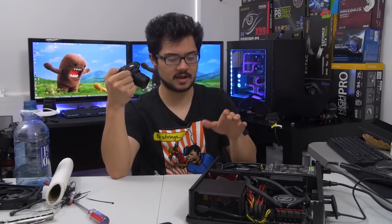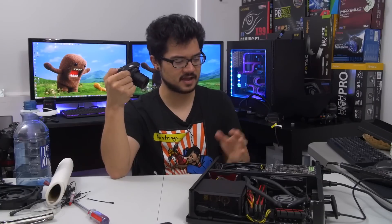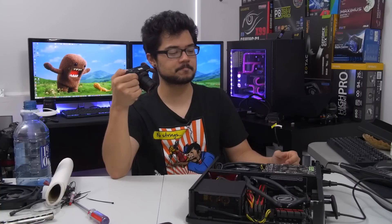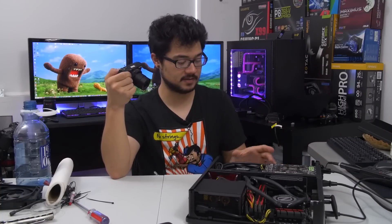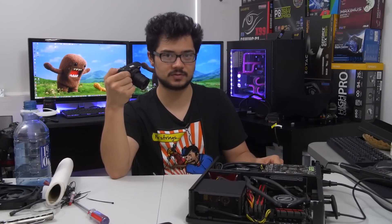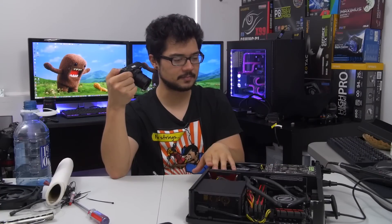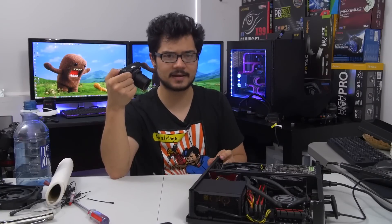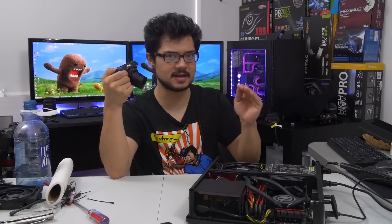I have just made a very unfortunate discovery. After we ran our little test, I powered the system off and just for fun decided to boot it up one more time to do some final testing. We got air bubbles. Turns out I didn't fill the loop all the way with water. These AIO coolers are not meant to be opened or refilled in any way — that's just not how they work. I was getting some really bad whining noise from the pump, just running dry. I booted up a hardware monitor and the temps were skyrocketing into the mid-nineties to the high nineties — almost hit 100 degrees Celsius on one of the cores. I eventually just powered the system off.